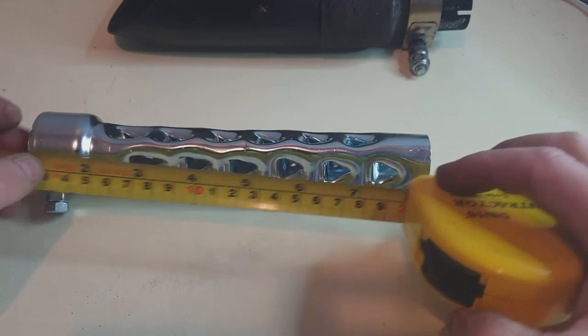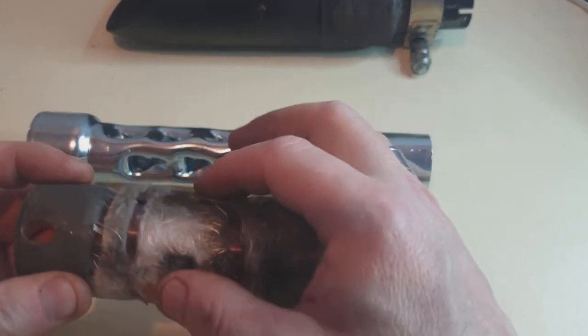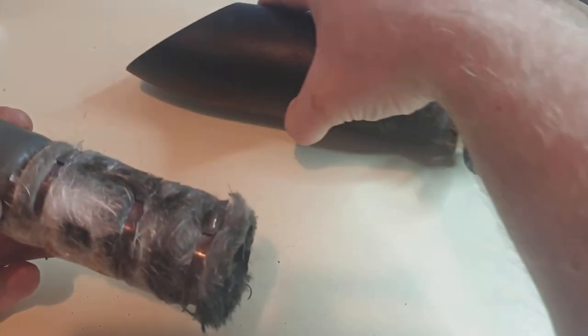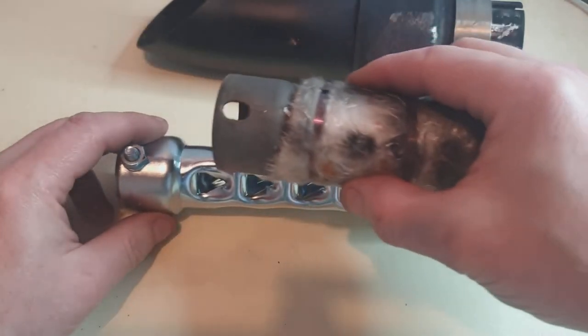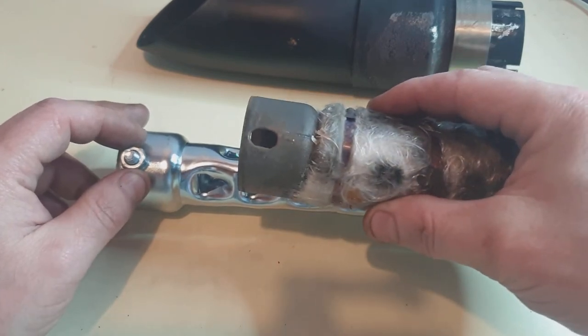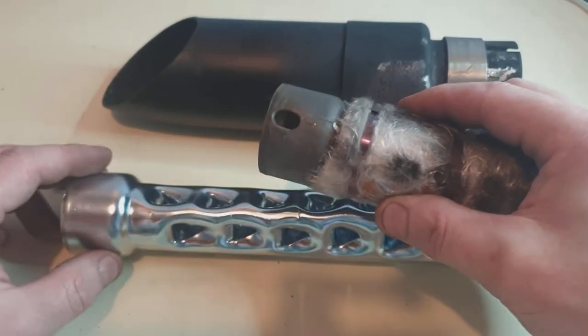Once I cut it down, wrapped the gauze around it, and put the metal cable ties on, it will stuff back down into the exhaust. Now, the new baffle comes with a bolt — there's a little bolt in there and a hole — but the trouble is the hole didn't give much chance for adjustment; it felt a bit loose and was rattling around inside the Radiant Shorty.